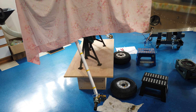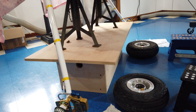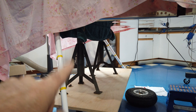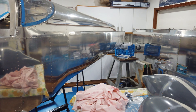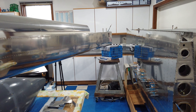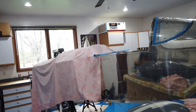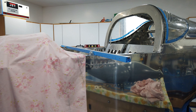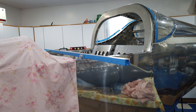The next step was to get the airplane off the ground. I use what I have on hand as best and as safely as I can. I've got a wood crate underneath, a piece of plywood on top, jack stands on top of that, and then a board running left to right covered with a towel at the very front of the fuselage. In the back I have my engine stand and a crate. I've checked level on the tail deck, on the longerons, and with my blue bar across the longerons - everything is within 0.1 of a degree of one another.